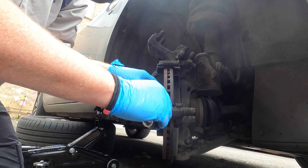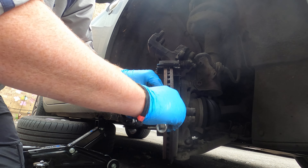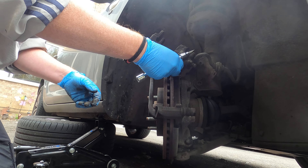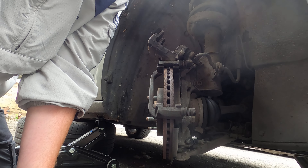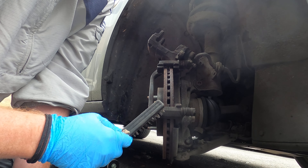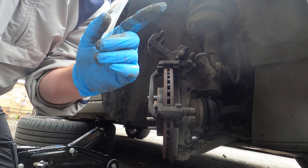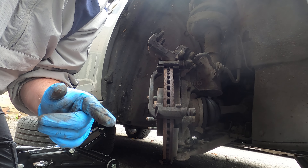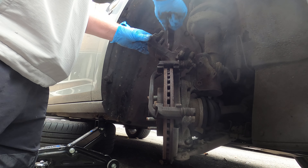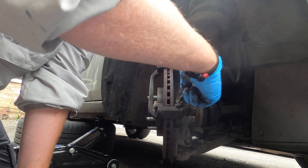Here is the old brake hardware. Because I bought Brembo pads which come with new hardware, I always like to replace it - just lever them off. They come off fairly easy. Put them in the waste pile. Then take a wire brush and give it all a little brush over to get any dirt off. Start with the caliper and give it a go. Bear in mind brake dust isn't good for you - you should wear a mask and try not to breathe it in. Do the caliper shoe as well.